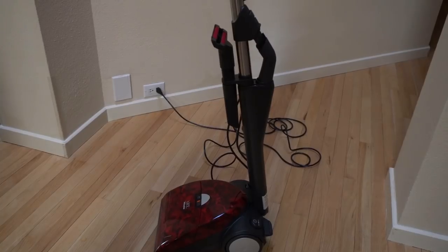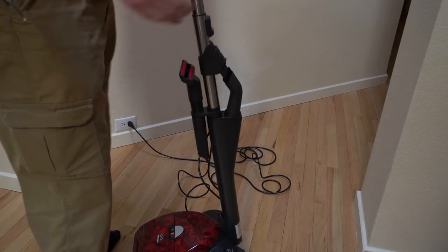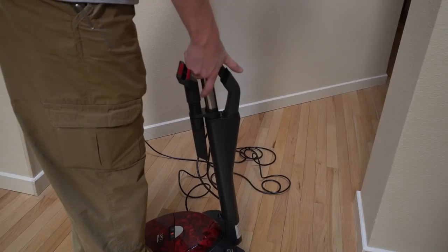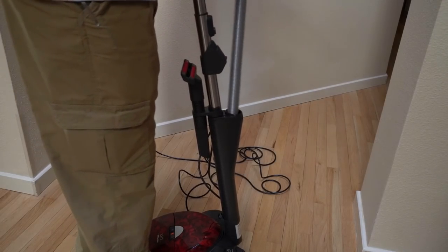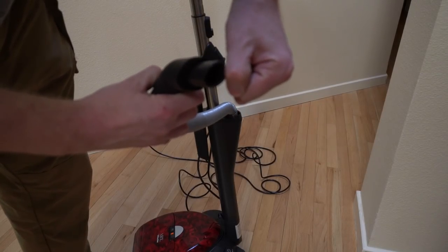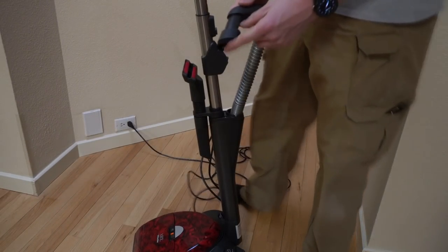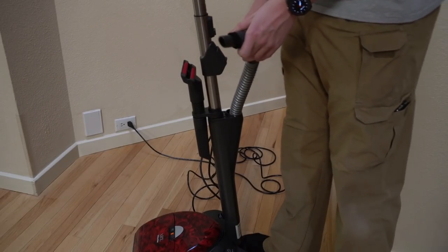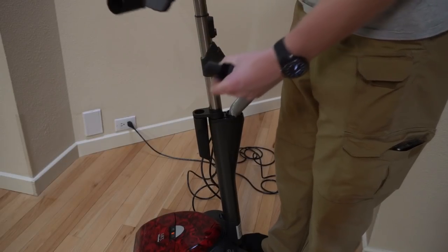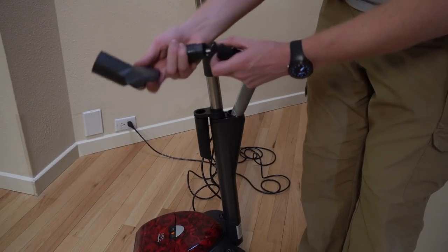So let's talk about the many quirks and features the Art has. We're going to start with the hand tool situation, which is the most bizarre thing I think I've seen in the industry. So this is a suction relief valve — so if it's hard to push on carpet, you can open it. It's also the release for the hand tools. And here we have a very small restrictive stretch hose — you can see how small it is. Then we have the world's smallest dusting brush that they ever produced on a vacuum that was high-end at least. But then you notice they're not using the standard Miele fitting, so tools appear not to fit on it. And I knew several employees who could not figure this out even after showing them.